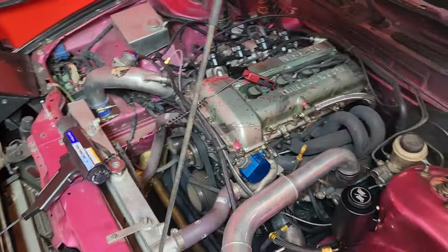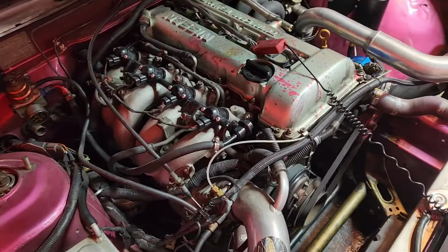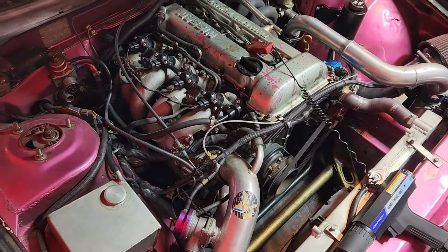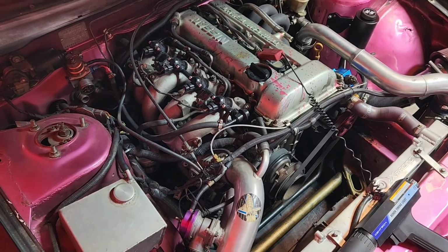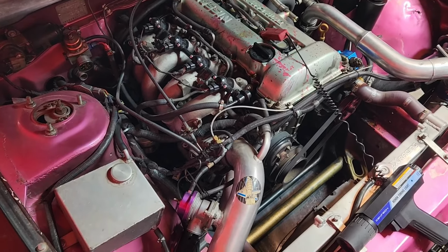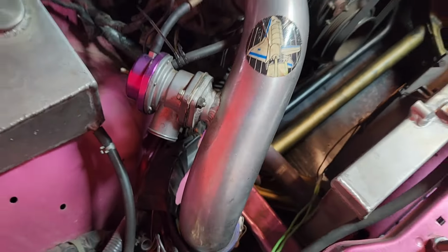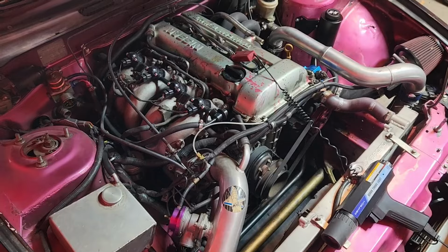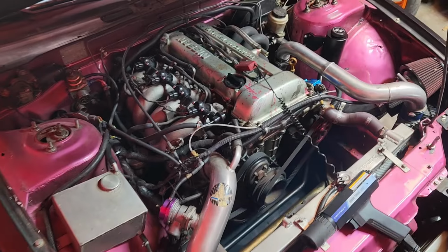so I looked for vacuum leaks everywhere on the manifold. I checked like the seals on the injectors, and I just couldn't find anything leaking. I didn't do a boost leak test on it. I didn't have one of those fittings for the turbo, but I let it run idle, and I sprayed brake cleaner everywhere, and nothing changed. I made sure everything was tight. I added some zip ties to some vacuum lines, and while I was there, I made sure all the clamps on the intercooler piping were tight, which wouldn't cause it to not have enough vacuum, but I did a lot of that kind of stuff, making sure everything was good, and I couldn't find anything wrong.